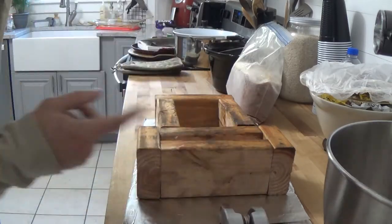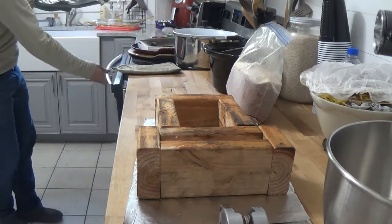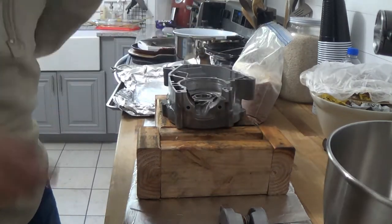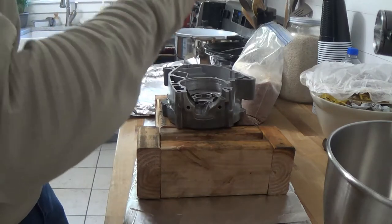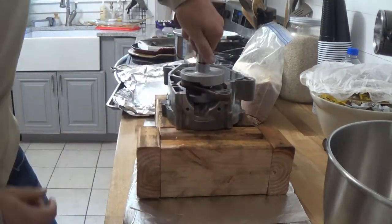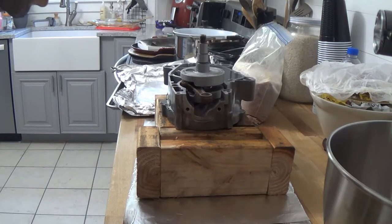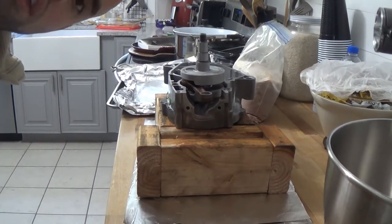This isn't as cool as we want it to be — it's been about an hour. Pull our case out. Left side case — we're going to put the tapered end down in the left side. Here goes nothing. Boom! And that's it. So that worked out well, just had to give it a little push and we're in. Looks like you don't need an overnight — an hour in the freezer, 400 degrees for the case, and we're settled in.